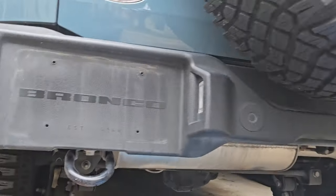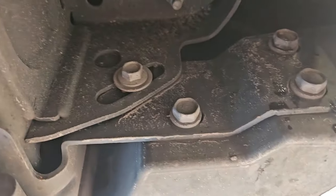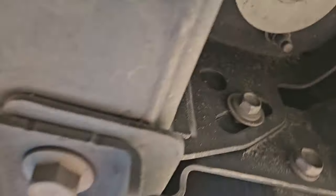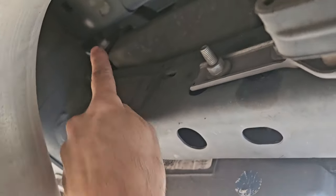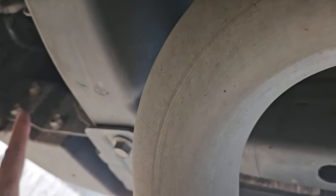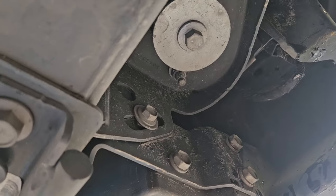From the back, up here on the very edge you have three bolts that need to come off — three, but there's one more that's kind of hidden up here, so four. And the same thing on that side: one and then three. So removing these eight bolts, I'm going to try to loosen them up and pull this thing back. Do not remove the bumper until you unplug the wiring, because one wire is for the sensors and one is for the license plate light.